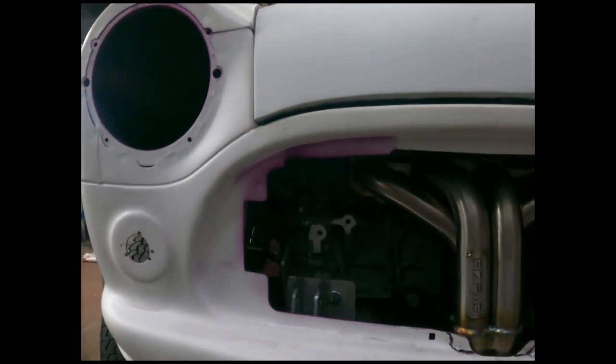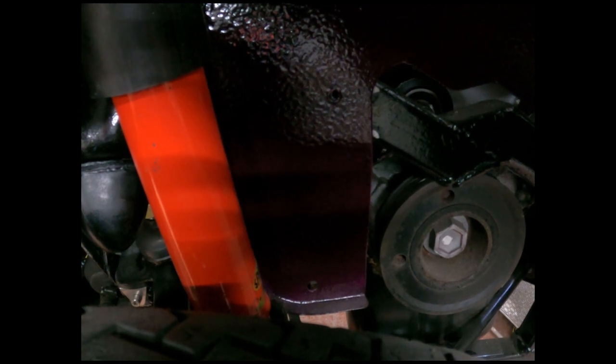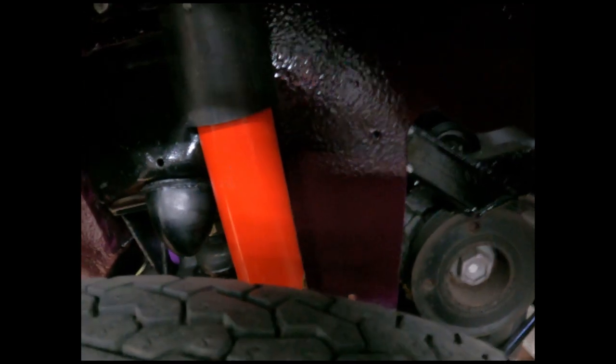And then I've got to sort out that alternator, the little Denso alternator. Couple of problems with it. One is it doesn't seem to spin fast enough to charge the battery. I think that's to do with the fact that the new alternator is running off the smaller cog, because that cog there on the end of the crank is stepped. There's a big cog there you can see, and behind it is the little cog, and the alternator used to run off the big cog, but now it's running off the little cog. And the gearing, like on your mountain bike or your racing bike, means that that slows the alternator down. The alternator doesn't spin as much. So I've managed to find a smaller pulley to go on the alternator, which should hopefully spin it a bit faster.